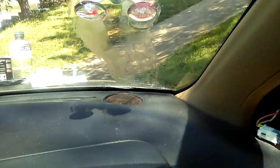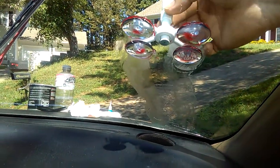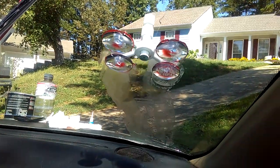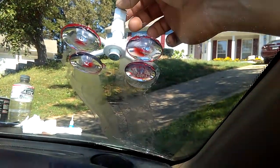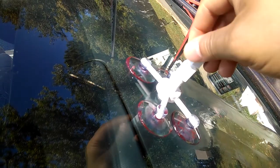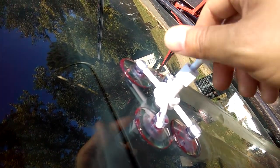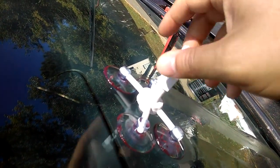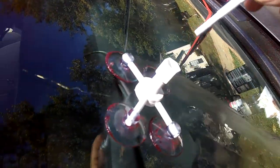Go ahead and turn the resin chamber — which is this — after you hook up the legs and push it down. This resin chamber will push the leg down harder so it has some pressure to push the cracks open. And the pressure driver — which is this — you want to take the pressure driver and turn it loose all the way out to refill your resin. You should already have cut your resin bottle tips at this time. Sometimes it has a lot of pressure and you see some bubbling — you have to loosen it to release the pressure.